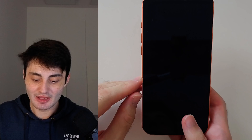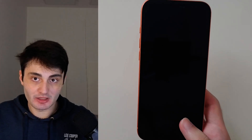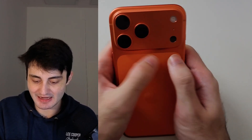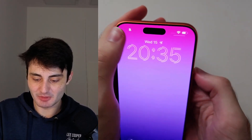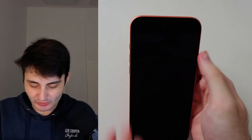If that's not working, what's probably happened is your battery or display cable has unplugged from the iPhone. We don't need to disassemble the phone to plug back in the cable. Instead, we can use our fingers and try to push the cable back in from behind. With our thumbs, we're going to push down across the entire back of the iPhone at maximum force — just push down as hard as you can. Do the top part as well, around the camera lens. Then do that same motion for the entire front screen.